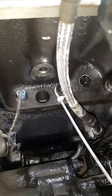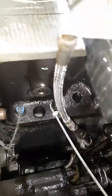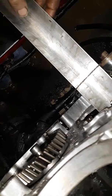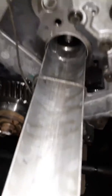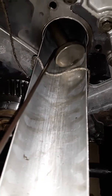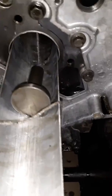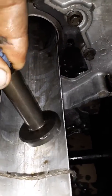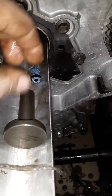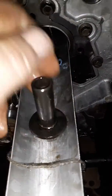Once your piece is in there, just pull that up enough so it's lifted out of the way, flip your tray over, and then it'll drop down into the tray. You can see it sitting down in there. I just made this little rod — just pull on it and it pulls right out. Pull it on out of the way, take your thing out, take your old lifter out, and get your new lifter set up.